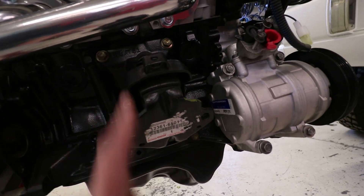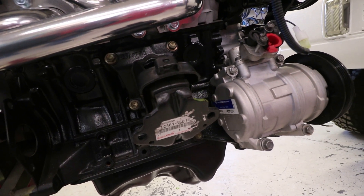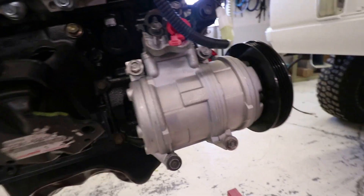On the crossover pipe with stock manifolds it's actually more or less necessary to have that installed first. The engine mounts that we typically like to use that fit the best are from a 91 to 95 3 liter 4Runner four-wheel drive pickup with the 3VZ — they're a very nice bolt-up.